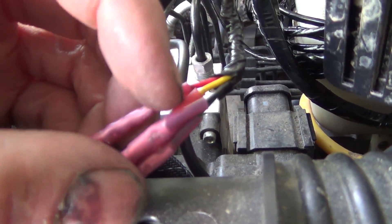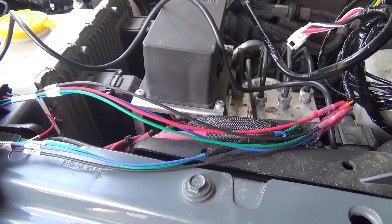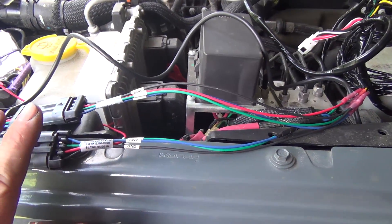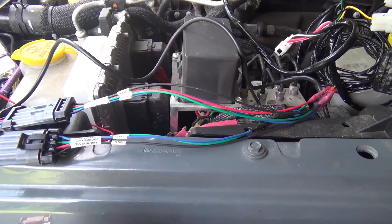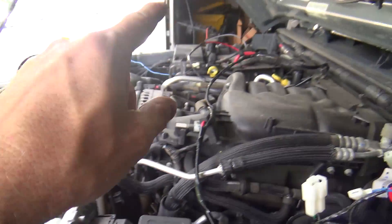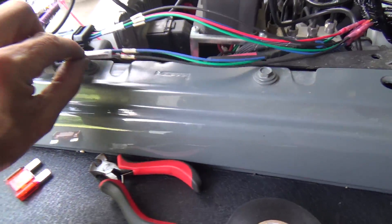I cut off the spades off the end of that and figured out my wiring strategy. I did leave it a little the same as how they intended — you have to turn on the main isolator switch in order to activate the two locker switches. The cool thing is I can basically leave the two lockers on and then just use the master switch to engage both lockers at the same time if I wanted to. And obviously I want to use the air compressor without lockers. The power for the switches is going to come off of the fuse box on a tap where I already have a tap for my dash camera, so it comes on with the key on and activates the switches.